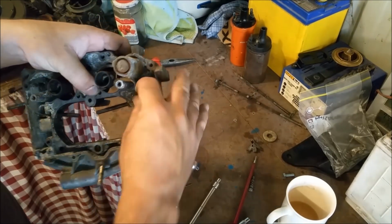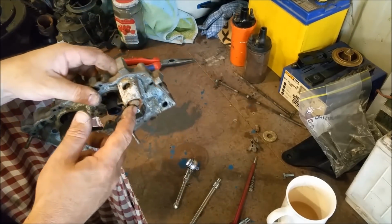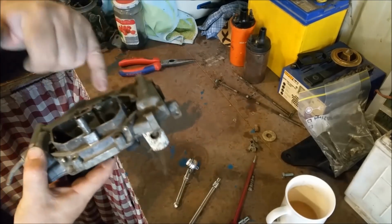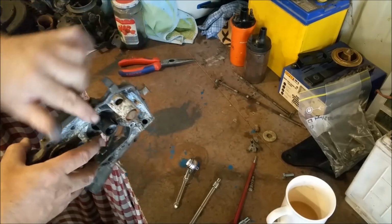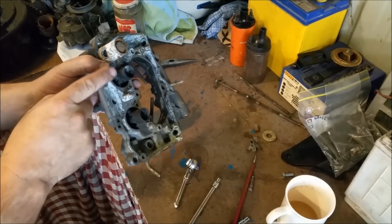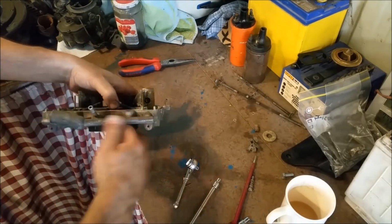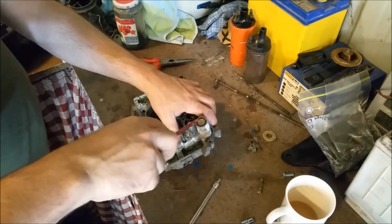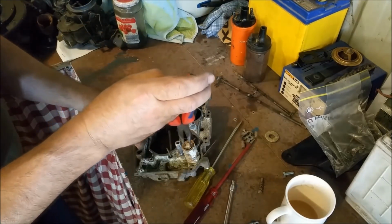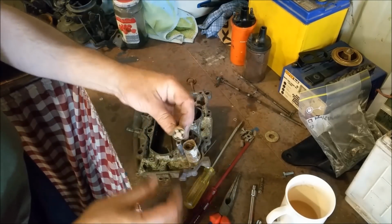And so you can see, once you get moisture in them, they turn to white powder, everything corrodes. Inside the accelerator pump there, which is difficult on a thermoquad because it's in its own chamber and has a very small spigot for the fuel transfer to the discharge nozzles, it's very easy to break that stuff. So that was the reason I pulled it all apart, or pulled both of them all apart. Of course, everything was hydroblasted, and of course, it was plated as well. The plating stuff wasn't that great, the quality of it. Here we go, look at the powder coming out of that. But we did get there in the end.